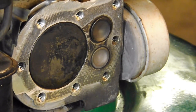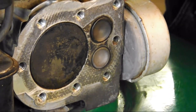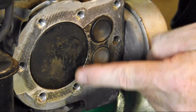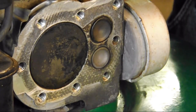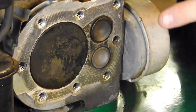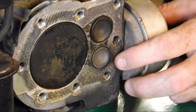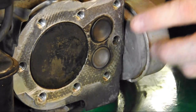The first part of a four-stroke engine is what we call the intake stroke. A stroke is the full travel of the piston in the cylinder from top dead center to bottom dead center. It doesn't matter if we're going up or down — that's considered one stroke. So the first stroke is the intake stroke. Before we get into that, notice there are two valves right here — one is a little bit larger than the other.